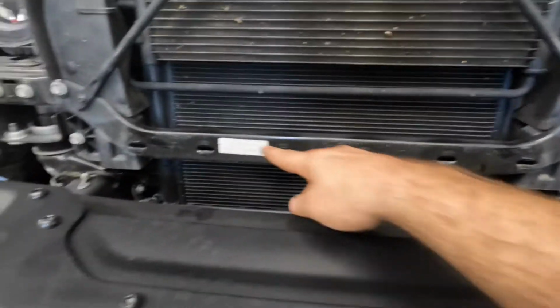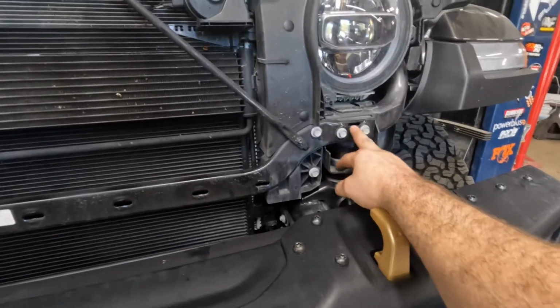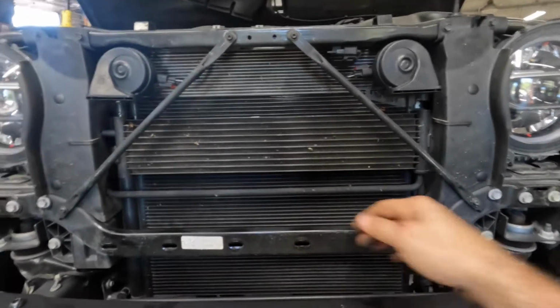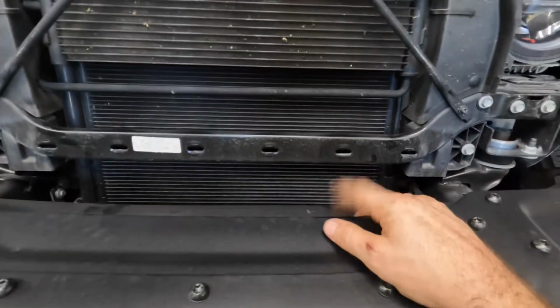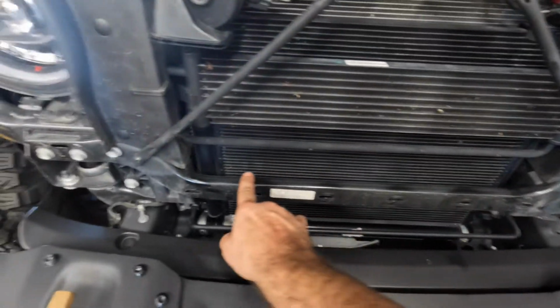These are the bottom clips I was talking about. So the grill just kind of pops in there. There's one over here as well. And then the Christmas trees up along the top, get those removed. I always put my hand down here and pull. That way, if anything hits the bumper, it's the back of my hand, not the grill itself, so we don't do any paint damage. So where I'm thinking for the first strip lighting is right down here.